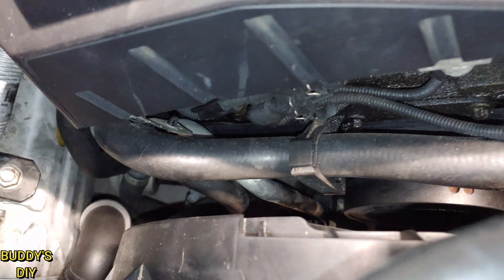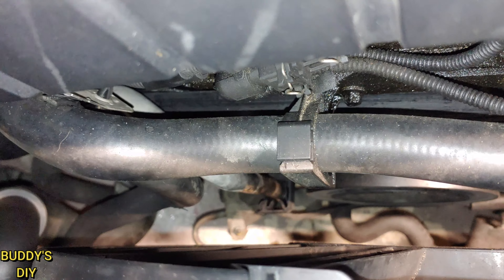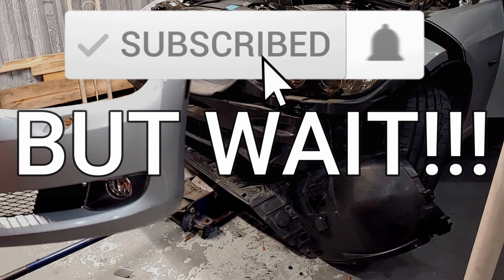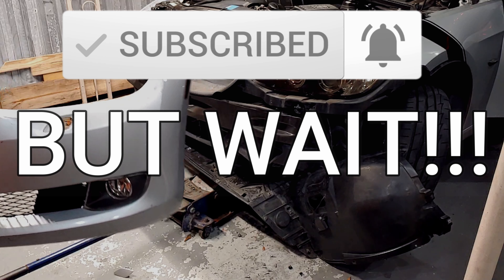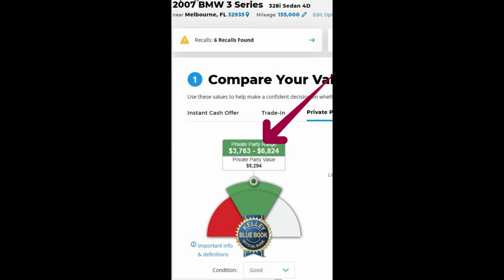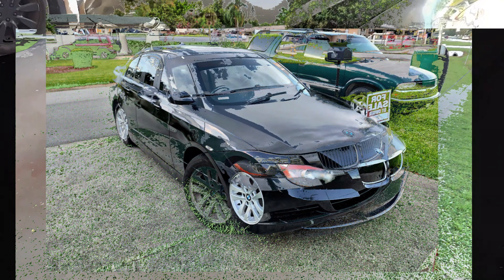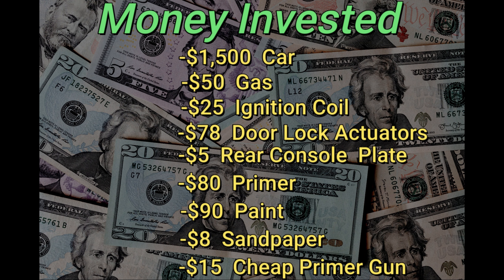Coming back under the car, we're going to remove the T25 screw holding up the cooler. While we're down here, let's also remove this little bottom cooling hose. Coming over to the upper radiator hose area, there's one last thing holding the fan in place — a little clip. Get a finger under it, pull it out, and lift the cooling fan up while releasing that tab. After the fan is removed, come to the passenger side of the radiator and pull this little retaining bar out with your pick. They can be really tight, so wiggle it out if needed.